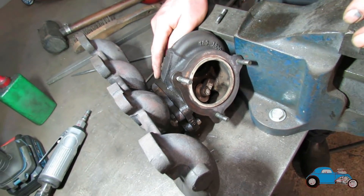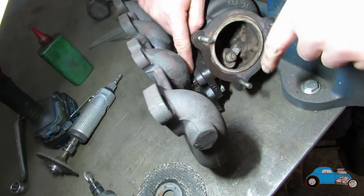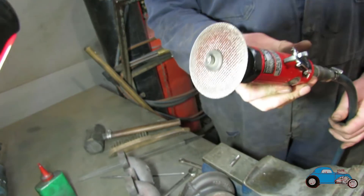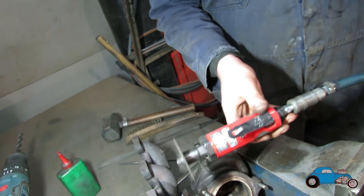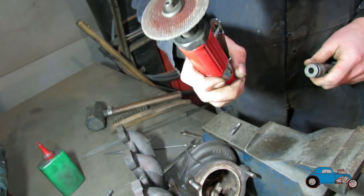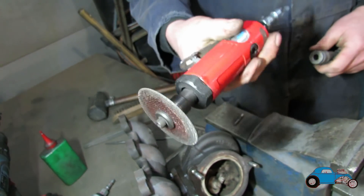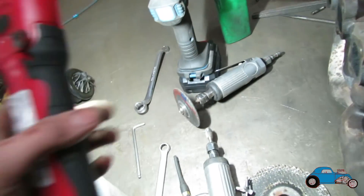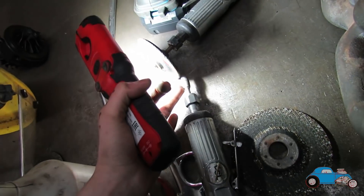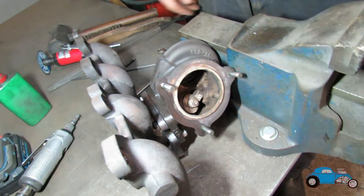So we've re-drilled the manifold and we've now got the new T5 turbo on. To grind that recess out in there, the tool of choice was that small air grinder — a perfect little tool. Got in there and it actually didn't take long at all. Just gently eased the metal out underneath the nut, and that even straightened it up as well. So if you do one, that's what you want to use. We did try a few other things — we tried a grinding disc, and we tried a deburrer.